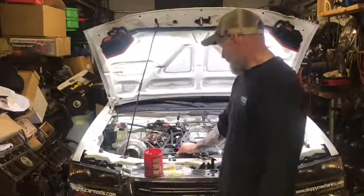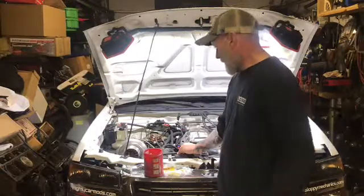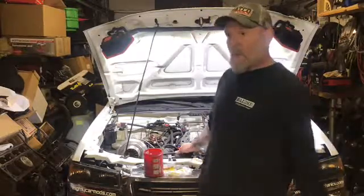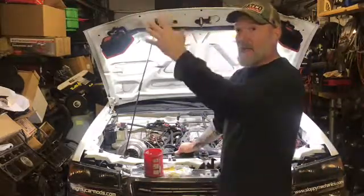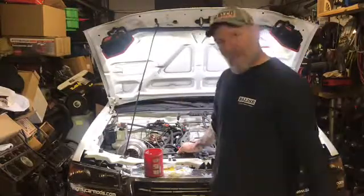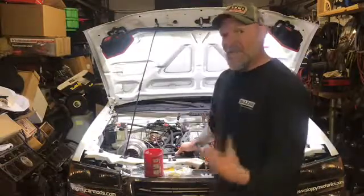And then the next thing, if I don't find anything there, actually, what I might do is just ramp the fuel pressure up really high and see if I can see it leaking from somewhere. So I might run like a bag of shit while I'm trying to search for that, but at least I'll be able to see where it's coming from.